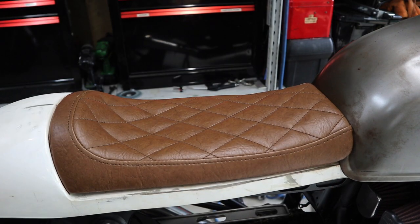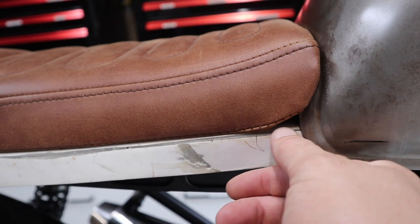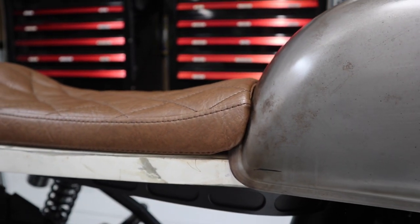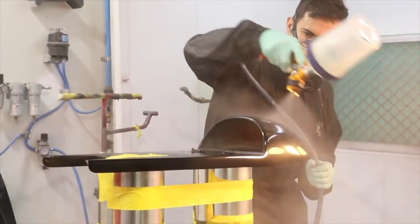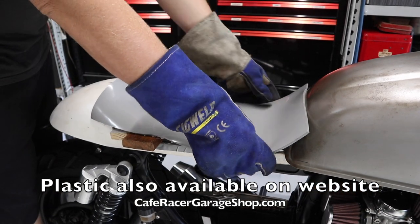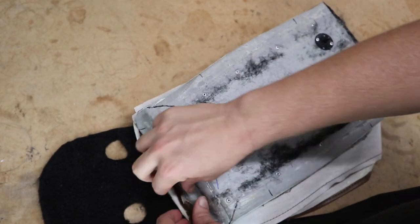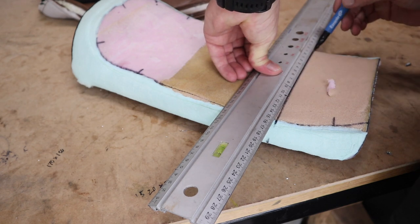When I first constructed these seat bases, I didn't realize how much of a difference it was going to make by having the fabric wrapping around the bottom section, which actually raised the seat base leaving a gap in the corner — which I'm just not happy with. The leather and the vinyl both have the gap and they've been fully upholstered and they look amazing, but unfortunately I'm going to have to pull them apart to get rid of that gap and get them reupholstered. These videos might be a little bit out of order — you may have already watched the tank painting video before I've released the upholstery video. All I have to do now is get a new piece of heat-shaping plastic and reshape the front section of the seat so that it folds down and covers up that gap, then cut off the old one, put in the new one, and take it back to the upholsterer.